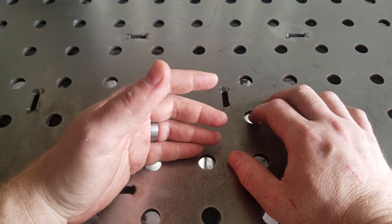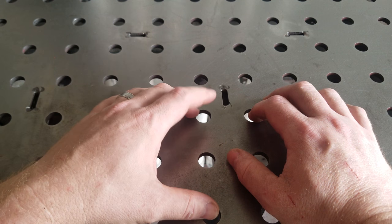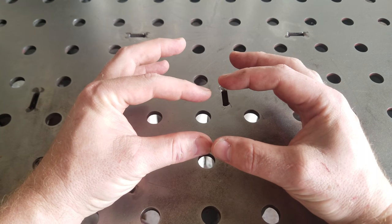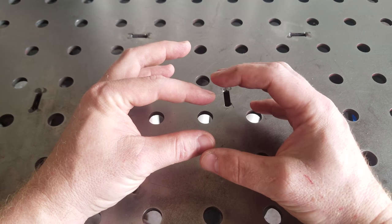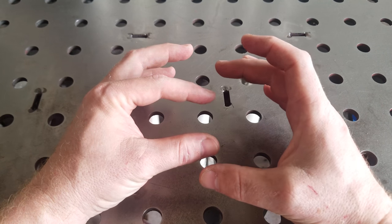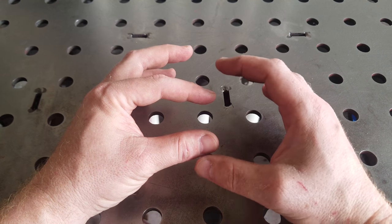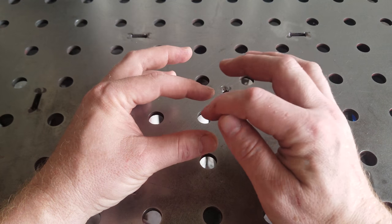The only thing I really could call an issue is with the exhaust — not with the header tube, but with the pit bike muffler. The way it's constructed, there's a metal sleeve that gets welded on the header, and then there's another sleeve that is an interference fit for the muffler. What happens is they've actually glued it with JB Weld or something similar. So as it vibrates and gets hot, it'll back out and fall off.